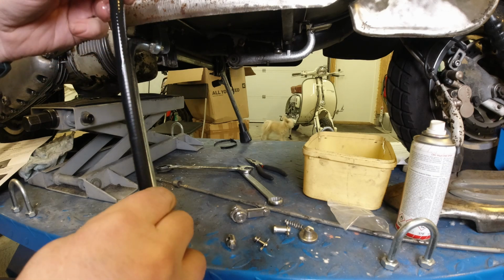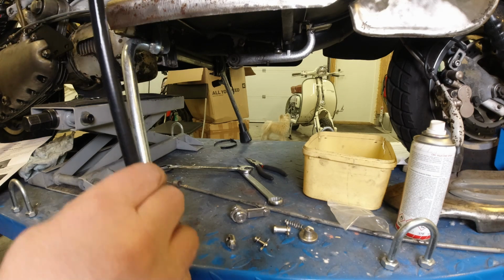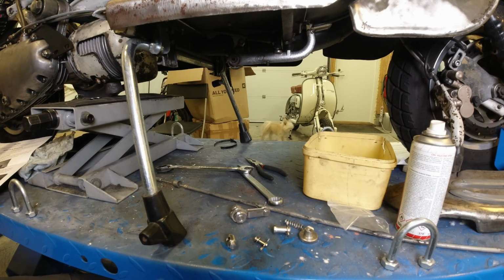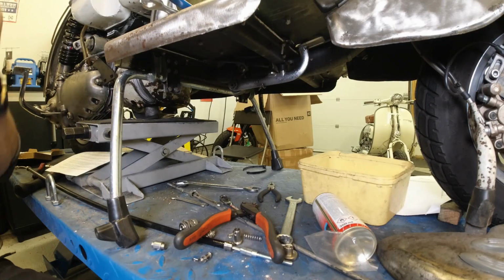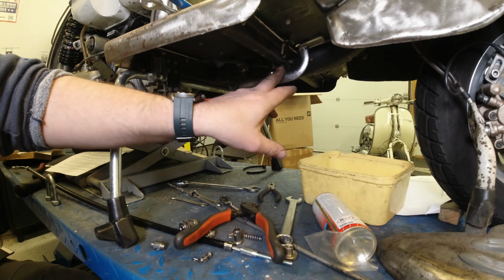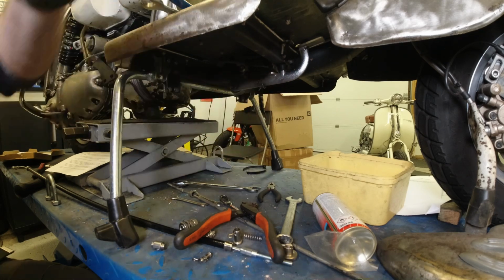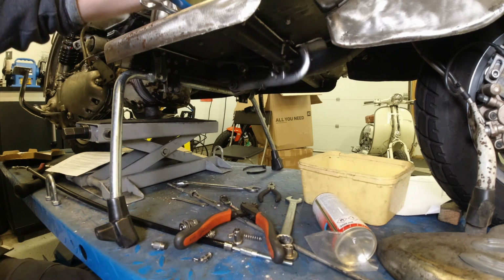That's PTFE. There you go. I can see it's running out the bottom there, so that's well lubed. And let's try and fit this thing. Right, the first thing I did there was I fit the rubber grommet that comes with the kit, and I moved my light switch down a little bit so that it makes contact with the brake pedal.